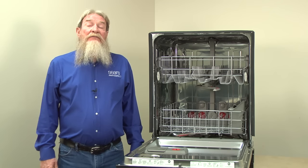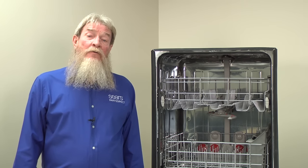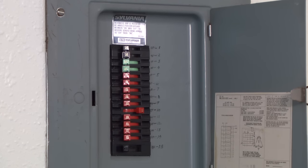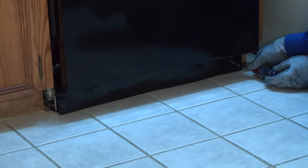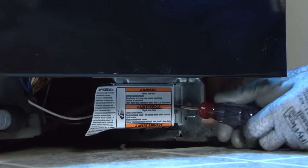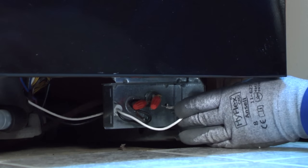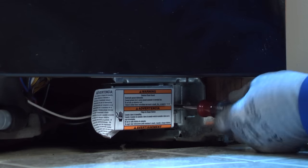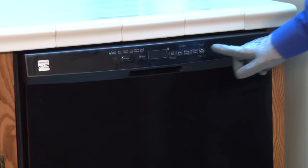If it doesn't light up, have an electrician repair the bad outlet. If your power cord doesn't plug into an electrical outlet, then it's hardwired into the junction box. Check the power cord connections in the junction box. Shut off the house circuit breaker for the dishwasher to disconnect electrical power — you don't want electricity flowing to the junction box. After you shut off the power, remove the bottom front access panel and toe panel by removing the mounting screws from each side and pulling off the panels. Next, remove the screw from the junction box cover and pull off the cover. Check the black wire connection and the white wire connection. Reconnect any loose or disconnected wires. Reinstall the junction box cover, then reinstall the bottom front access panel and toe panel. Restore electrical power to the dishwasher and see if it works.